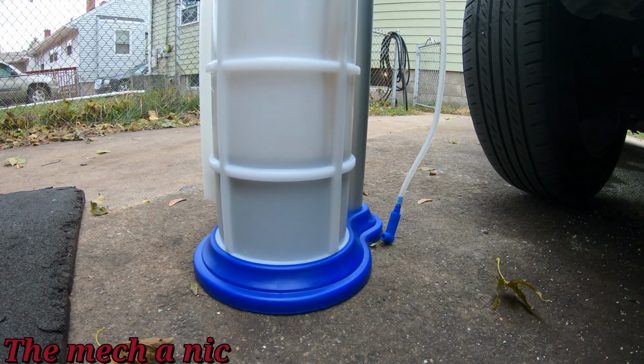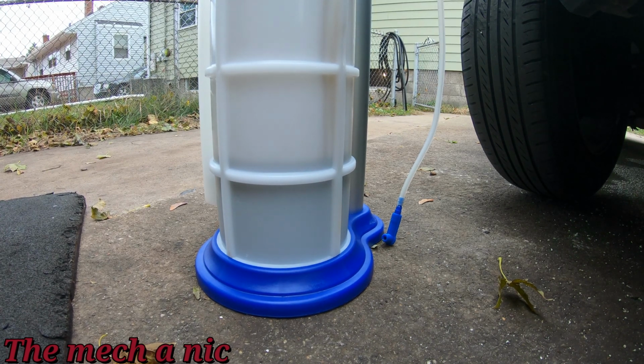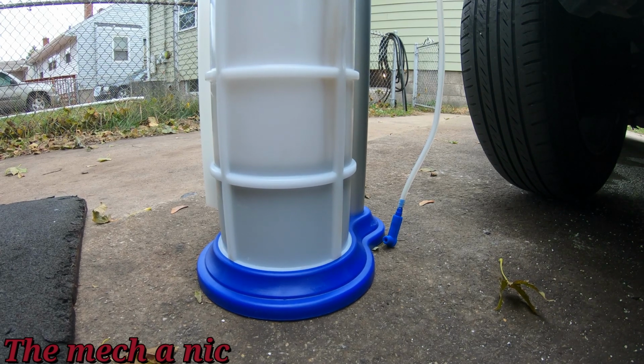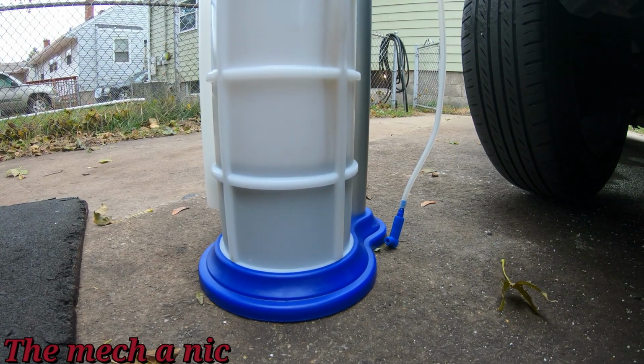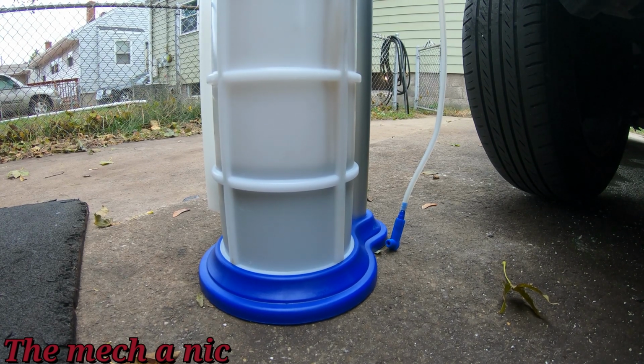Think of those oil changes on cars that have full belly pans and you have to remove all those screws to get to the oil filter, to the drain bolt. You can just suck the oil right out the dipstick, especially if the filter's on top in one of those canisters. It turns a 30-minute oil change into a 10-minute job.